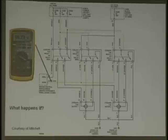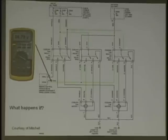Okay, how about this? The ground wire, 6 volts, 790 millivolts, 40 volt or 60 volt scale that we're on, right on that wire. What is going to happen? Where's this going? Up, relay pole. The PCM is calling for fan operation, and we've got that voltage on there. First of all, what would you expect to be happening? Will the fans be on with that voltage drop? No, probably not. Will you maybe hear clicking? Probably not, though. Too noisy.